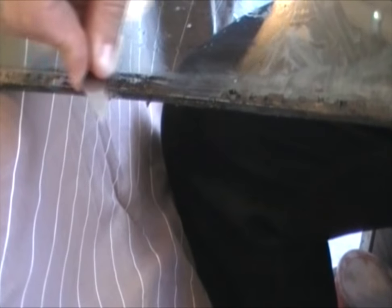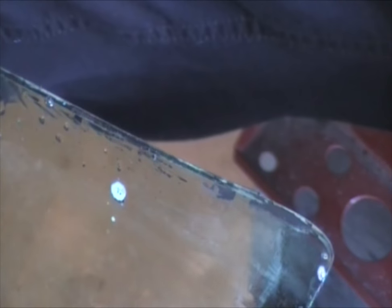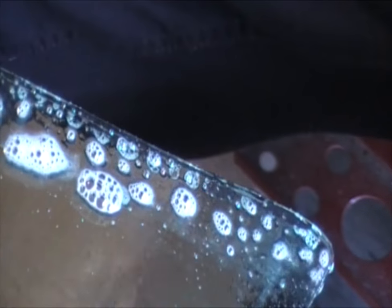The other important part is that you get this edge here, because if they have adhesive on it — and the front edge as well — you want to get it on this side too. The way you do that is flip the glass over and do the same thing on this side once this side is completely good to go. Sometimes just using a fresh blade will make all the difference in getting this stuff off. I've found the best method is to change out your razors pretty often, then wet down the surface like that.